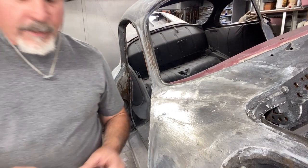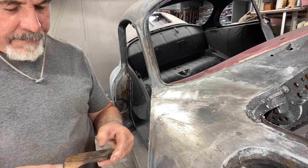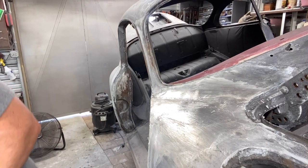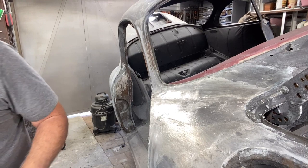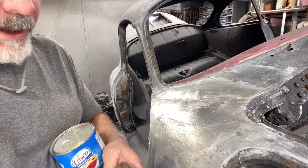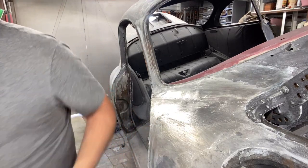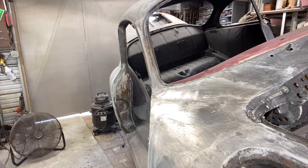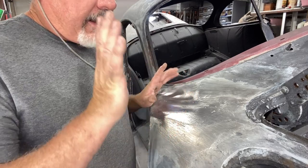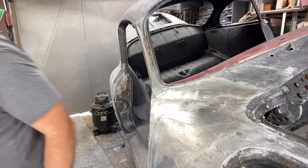I stole it from my wife's kitchen and I didn't want to buy tallow because tallow's not cheap, and you're just going to use it for this. What you do is wipe it on the paddle, then wipe it down with a rag — just enough — then heat it with a torch. It's good to sand the paddles down first, but for demonstration I'm just showing you a somewhat sloppy way. But I tell you, when you do lead it's got to be clean, it's got to be right — or you're going to do it over and over until you get so frustrated.